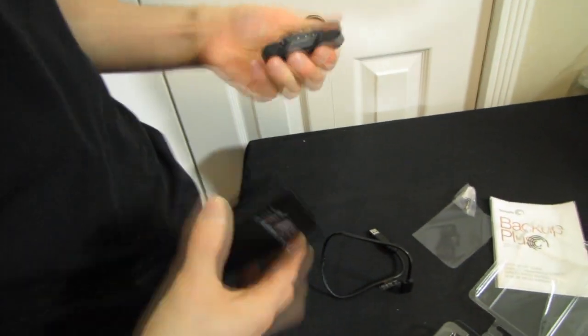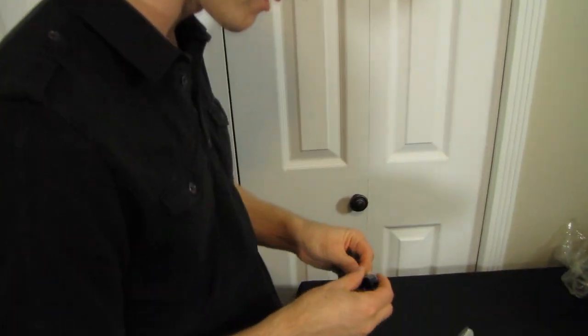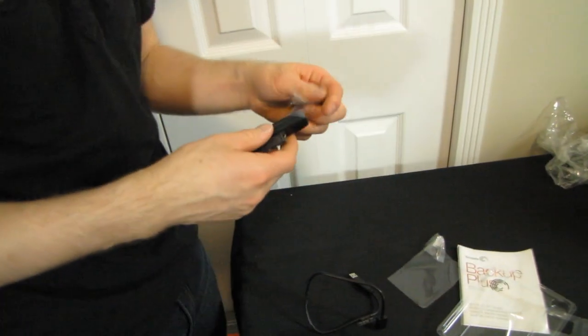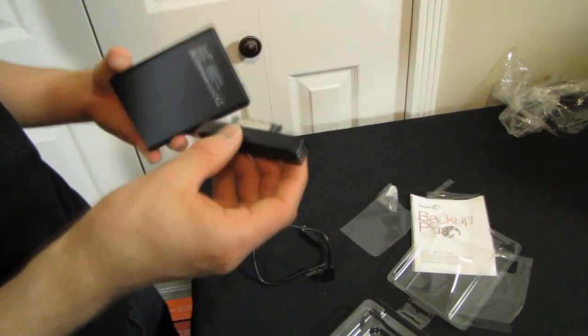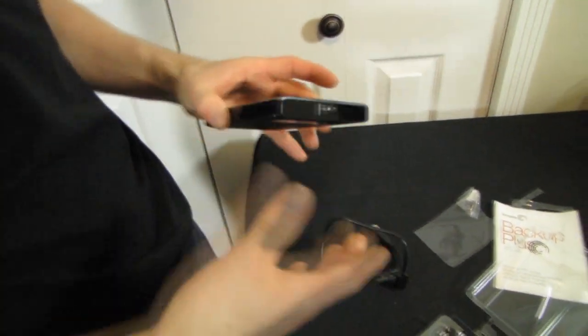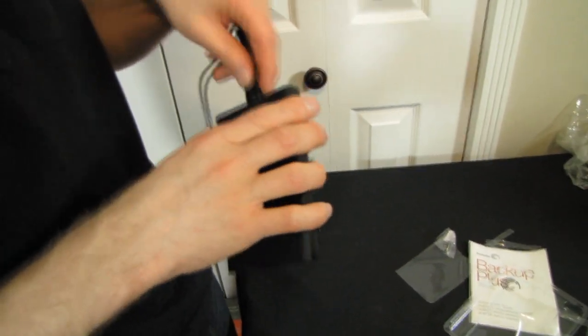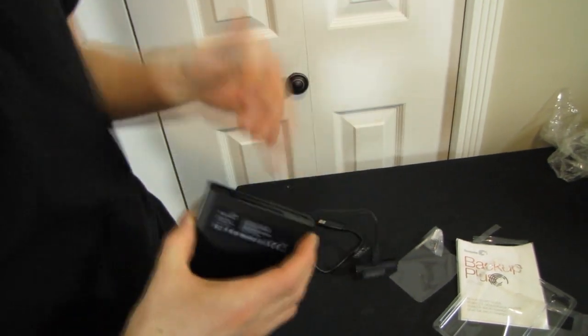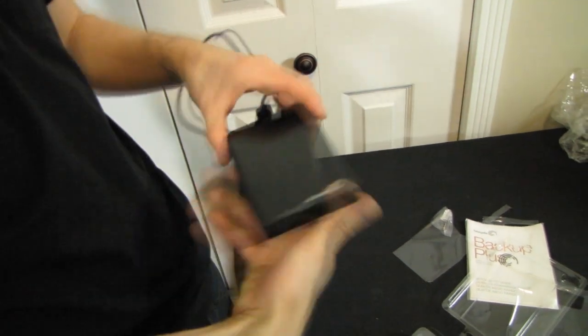This is what I mean about easy upgrade interfaces. This is just a SATA interface back here — very cool. I'm personally a huge fan of their GoFlex system. I don't think they're even calling it that on this drive, but it was originally called GoFlex — swappable modular interfaces. The chipset actually resides in the cable end, so you just click that in. Now it's a USB 3 drive because you've got a USB 3 to SATA chipset in there. Take this off, throw something else on — maybe eSATA, maybe Firewire. It doesn't matter. Just clip that on and you're good to go.